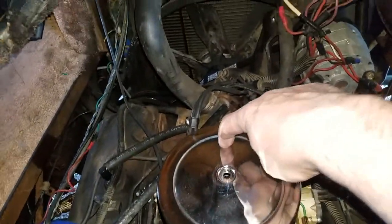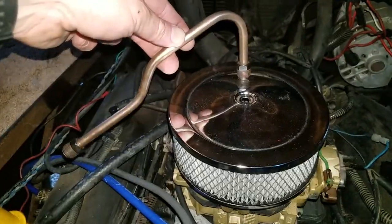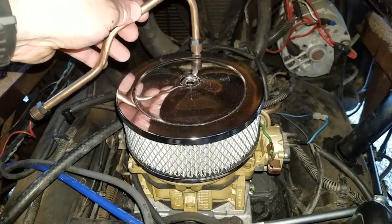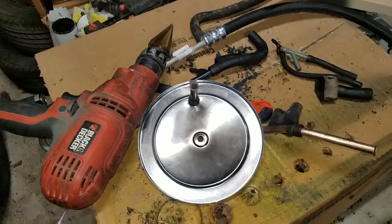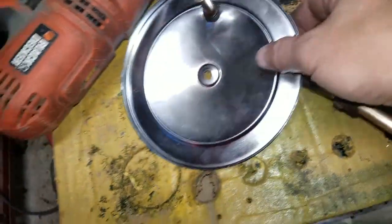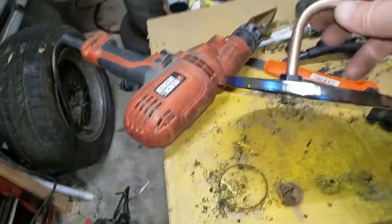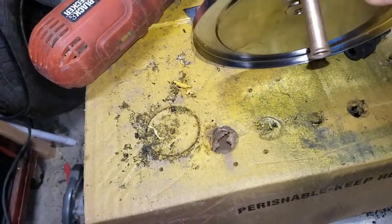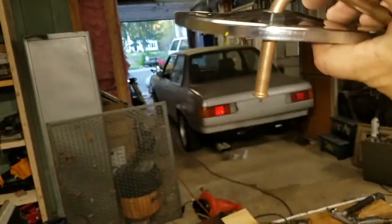So it's going to come down and just kind of stick towards the front end of the carburetor. As I flip this cover, there's going to be a hole right there. I've taken my little pipe bender tool and created my top-of-carburetor piece. It's going to go like that — further down inside. I used my step drill, took it to 5/8 inch, and drilled through the chrome cover. Then I used my planishing hammer and straightened it out a little bit for better grip, then took a crescent wrench. This thing slides up and down, which is fine. I just didn't want to go any further down than this — right above the primary portion of the carb.